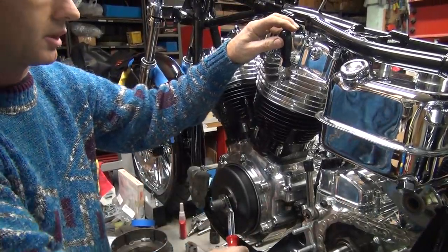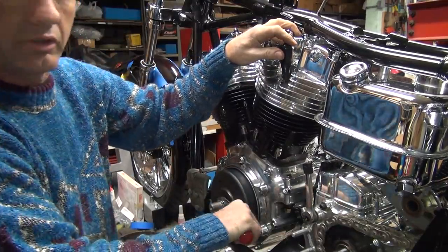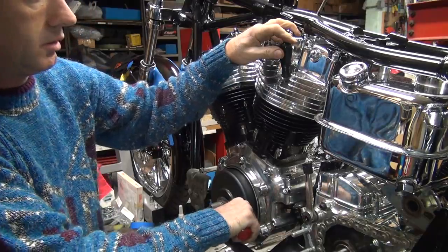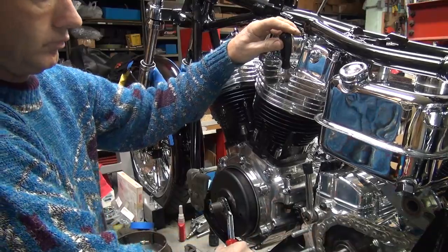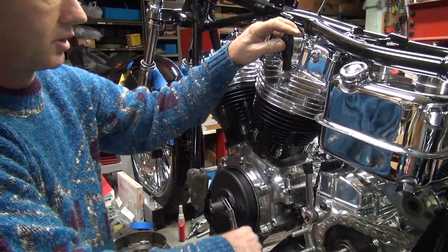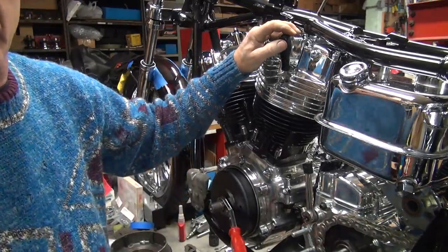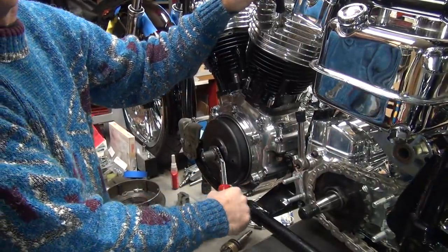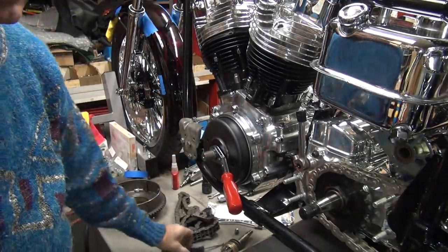The intake valve is open over there. Okay, now I'm going to rotate one more down. See, now we're working the valves. Right there's TDC. See, I'm fighting valve spring tension on another hole. See? So this one over here is fighting me right now. See, I'm coming back. There, it's staying right there. Perfect. Leave it right there. I got on top of the cam lobe, so now it's staying put.